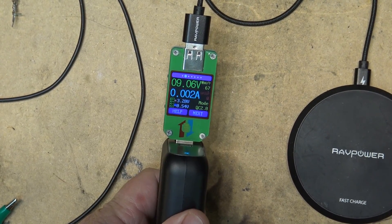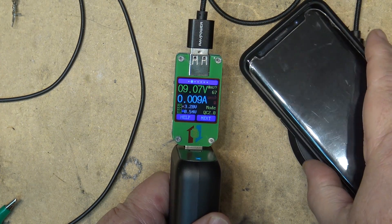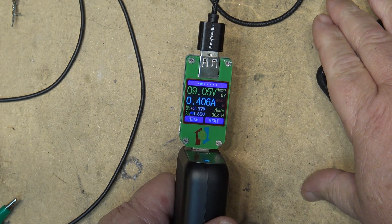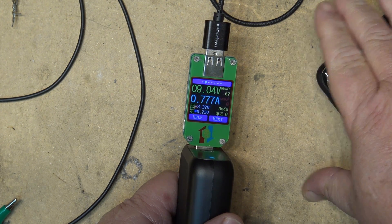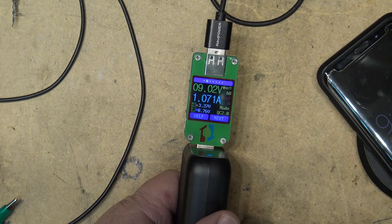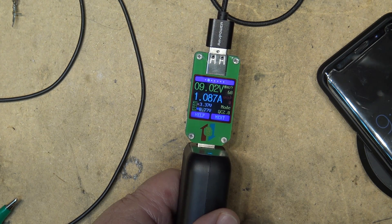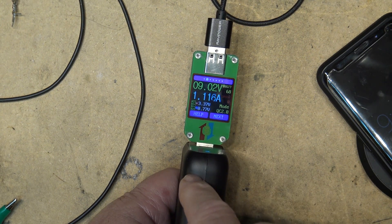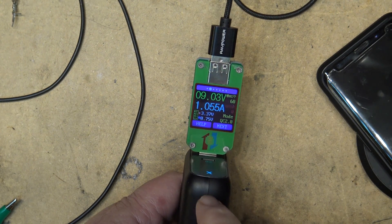Your results will certainly vary depending on your hardware. Using a RavPower fast charging pad, my phone shows 9 volts — that's a QC 2 charger, not QC 3, and only claims 5 and 9 volt charging. The other charger I showed supports 12 volts as QC 3. It all depends on your device — the charger will communicate with the device to determine its capability and select the appropriate voltage.